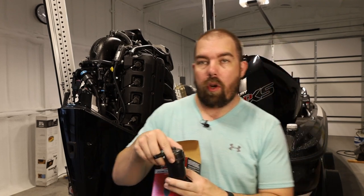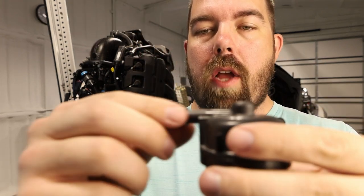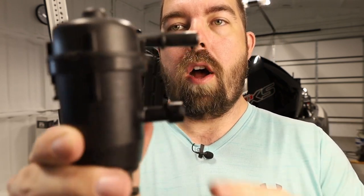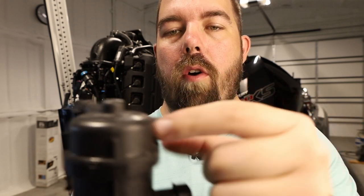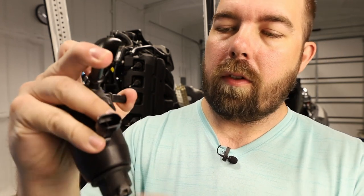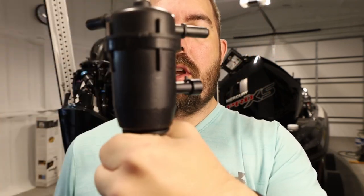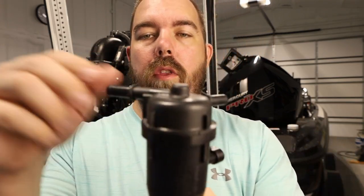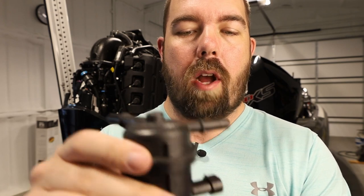Here I have the old one. I'll give you a better look at the fuel filter itself. This side was the outlet side going into the engine. This is the inlet side — the first hose I took off. Then we have the electrical plug. You squeeze the little red grommets that click over these ridges and the hose comes off — same thing on the other side. On the bottom there's a little ridge that the filter clicks into and sits in a little socket. You can connect the socket first and then connect everything, but the hose going away from the camera was more difficult, so I made that connection first before putting it in the socket — that seemed to help.